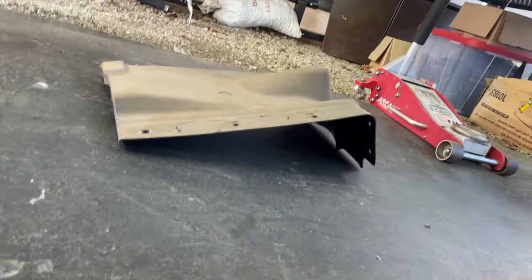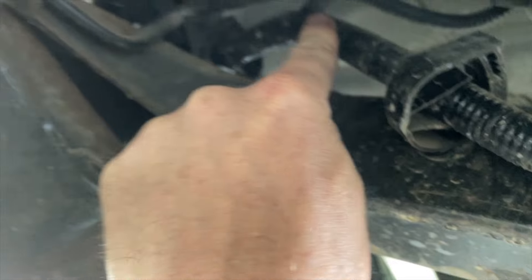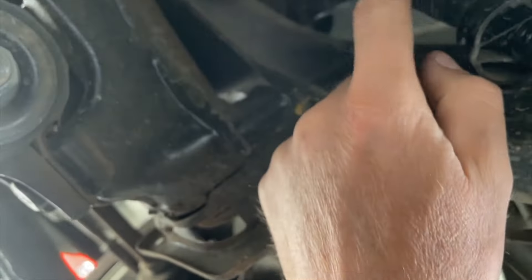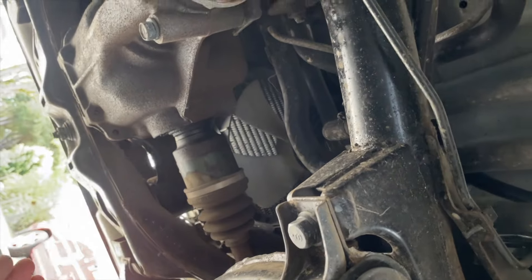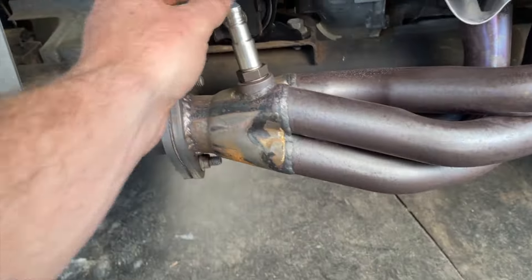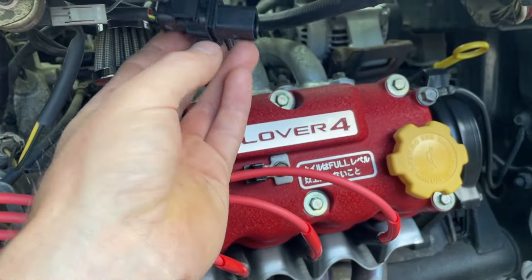Update: I got the O2 sensor in there. It's wrapping up behind the distributor, which is how the fuel-injected ones go, and I've cinched it to the distributor coil wire. I'll run it up in this wire loom. I took off two screws to remove the plastic wire loom cover in the engine bay, so I'll run it in that pocket — it's got enough room. Then I'll run it down. I'm pretty sure I'm going to have to lengthen it, but oh well. I also took the big plastic cover off, which exposes everything. The wire loom runs down toward the frame rail and then we'll follow it up to the cab. I'll try to find where I can pop through into the cab where the main wiring goes. I want to make it as clean as possible, not a hack job.